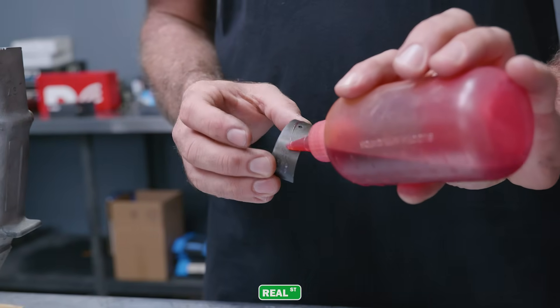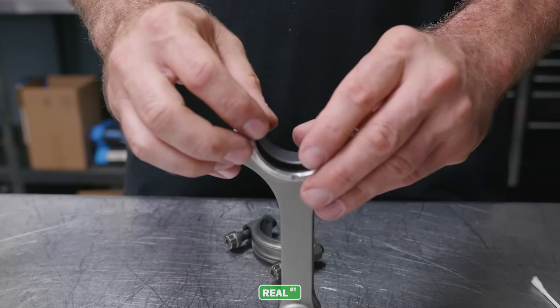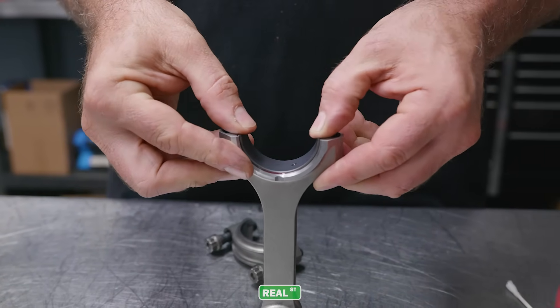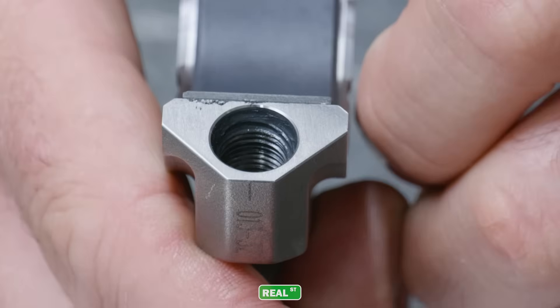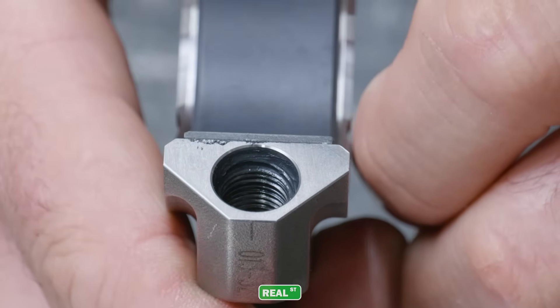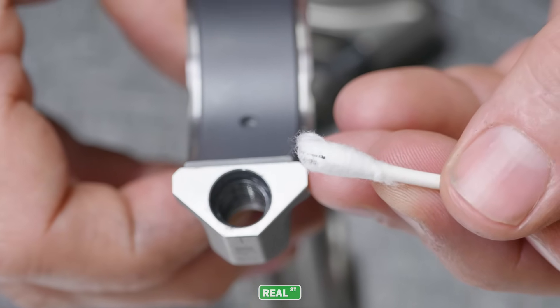What I do is put a light oil — like automatic transmission fluid — on the back of the bearing so I can slide the bearing into place. We're going to show you that there's some particulate that comes up off the back of the bearings. I'll clean those bearings, clean the back of the bearings. You never clean the front of the bearing; you never put anything abrasive on the face of the bearing because you'll damage it. As for the back of the bearing, you can clean it up if it's got a little fuzz from coating, because that will end up at the parting line of the rod. More importantly, putting oil there allows the bearing to slide into its location when those two surfaces meet, without buckling or deforming the component during that process.